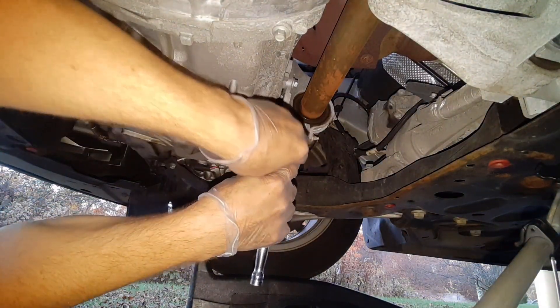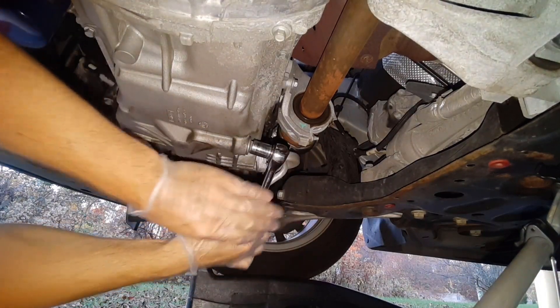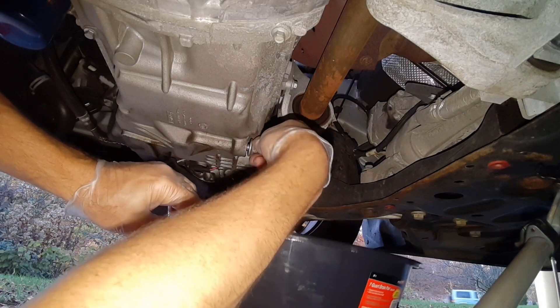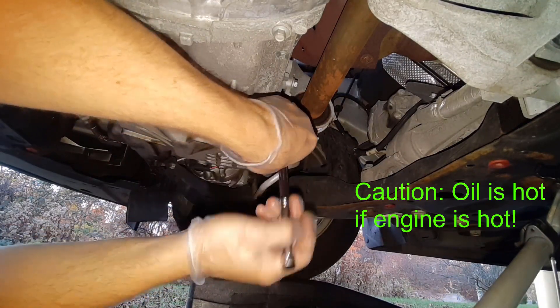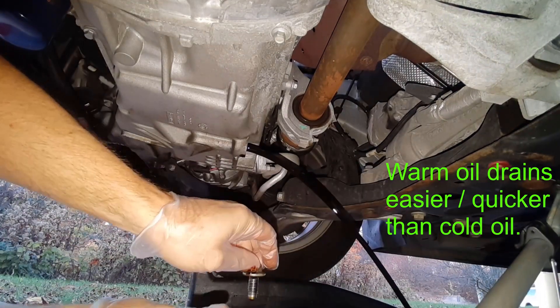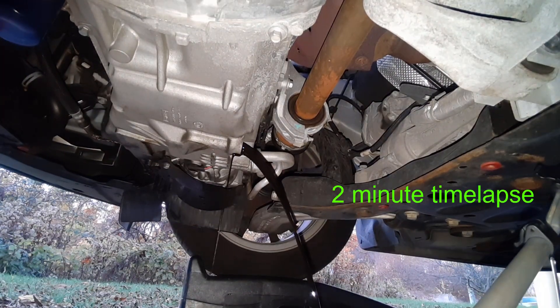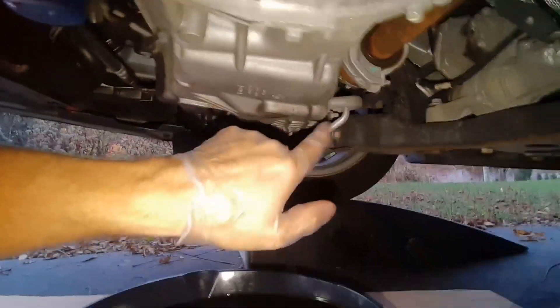Take your oil pan. We're going to take our gloves and our 15mm wrench and loosen this up. It's still hot — it's wise to let your engine cool off. Just let that drain out for a few minutes. So it's sufficiently drained; you might get a couple of drips and drops here and there. I'm going to move the oil pan up a little bit so you can see the oil is dripping into the pan. You might want a bigger pan.